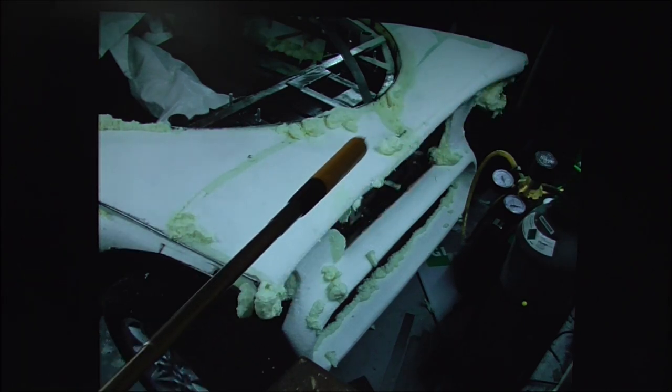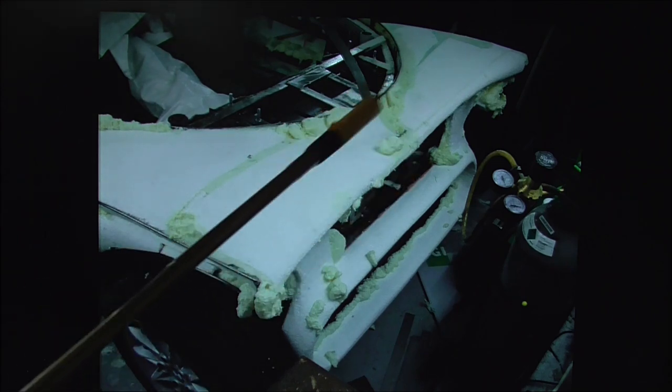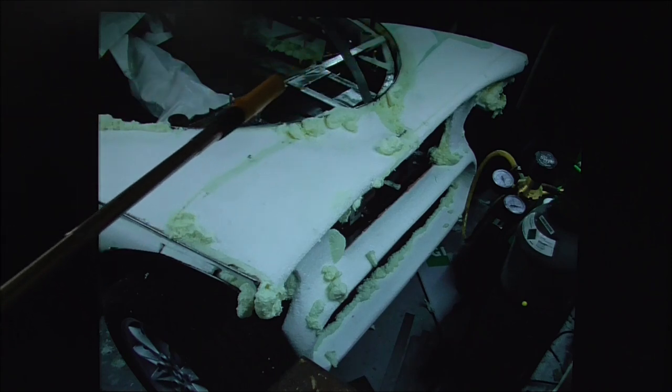Moving on to the rear — you can see the two wings coming in, and a good view of how the ring and all the bodywork around it work together. It was on the parallel motion hinge mechanism I used from the BMW Z3 boot — this dropped down and went up and pivoted around here, hiding all the hinges. On some builds they'll just have two stainless steel hatch hinges at the back and up goes the dome, but I wanted it to feel — and I always feel strange saying this — more like a production car.